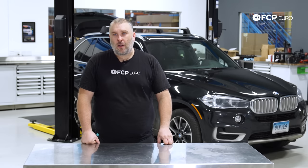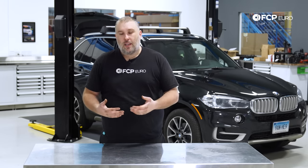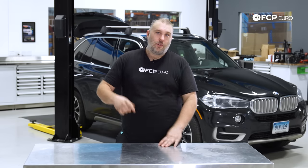As you can see, it's pretty straightforward to replace the brakes on an F15 X5. There really aren't that many tools required — it's a basic braking system that shares a lot of similarity with many other BMWs. So if you got a quote for a thousand, fifteen hundred, two thousand dollars for a full brake service, you can do it for a fraction of the price. Make sure you reset your warnings, pump the brake pedal several times to get a firm pedal before driving — you want those pistons to come back out so the pads are actually touching the rotors. Hope you learned something today — leave questions below, hit like and subscribe, and we'll see you for the next one.